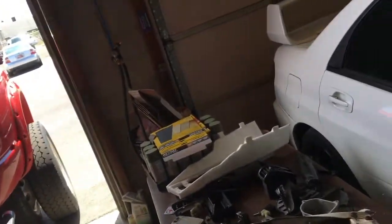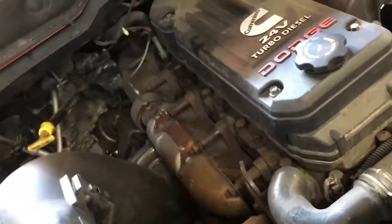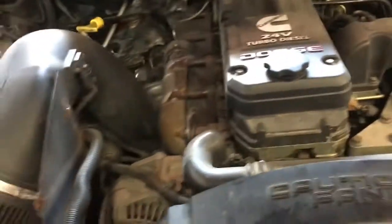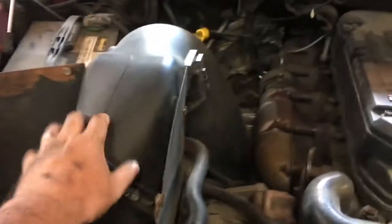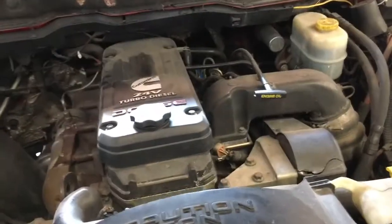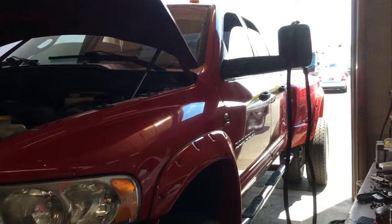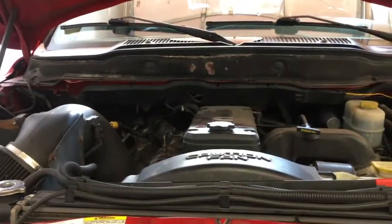For those who haven't seen it, this is my truck - my baby. The Diesel Brothers built it on the Discovery Channel, and then we did some extra work on it. It's head-studded, full turbo setup, has the manifold on it - I think it's an ATS or similar. Billet turbo from Industrial Injection, I think a 6280, stage-three injection, air intake, head studs, 22.5-inch Alcoa wheels, full Bilstein suspension, a nice sound system, all kinds of fun goodies.